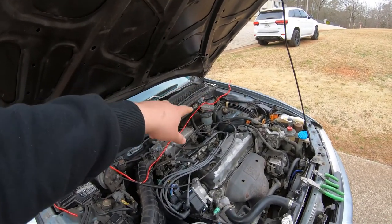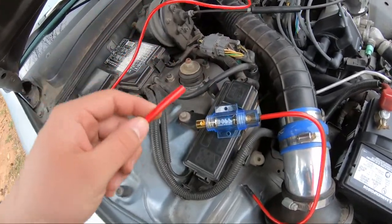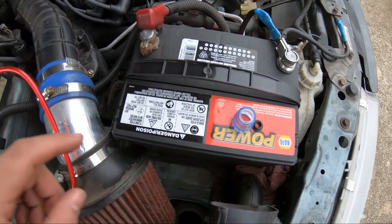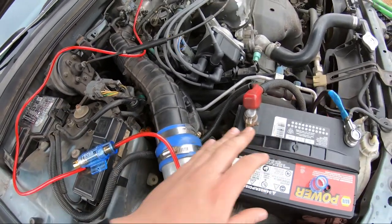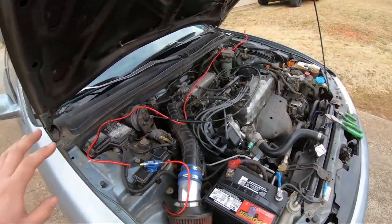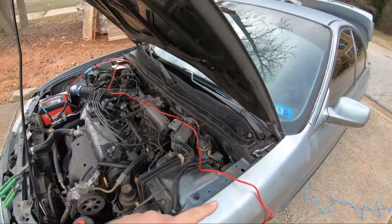I'm going to run it through the little grommet over here. What I'm going to do is set this piece up first, which is real simple — you literally just strip this back, back this little screw up, and stick the wire down in there. There's a little grommet piece to seal it and make it watertight so you can have it out in the engine bay. You need to have this as close as you can to your battery, just in case anything were to happen — your fuse will pop before anything else catches on fire or gets damaged.